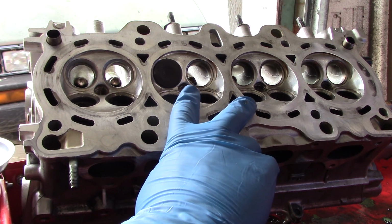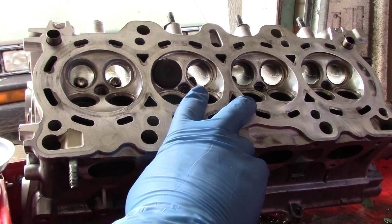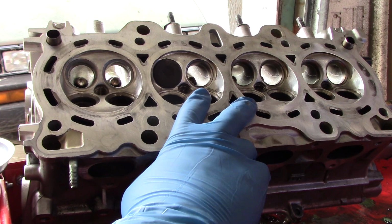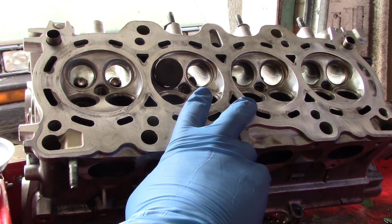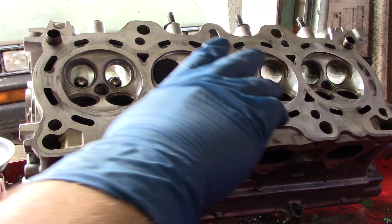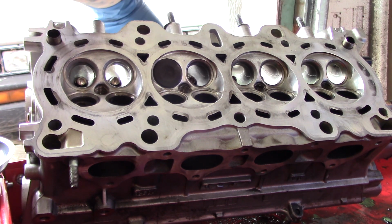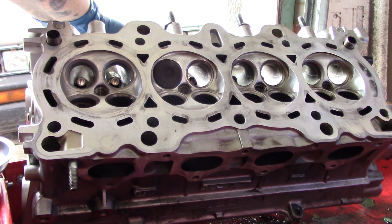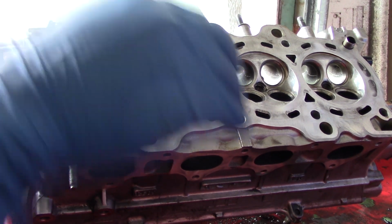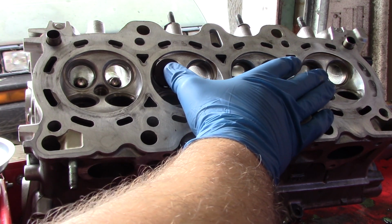So on the back side, you don't want to seat that tubing all the way down to where the valve guide would be. You want to have enough room to slide that valve in and out somewhere between a 1/4-inch and a 1/2-inch. The exact distance doesn't matter, but somewhere in there. And go ahead and get comfortable and seat your drill in there and settle in, because you're going to be here for a little while.